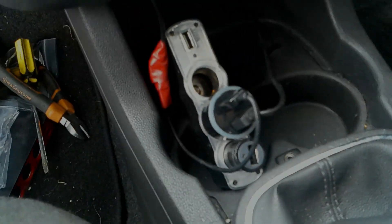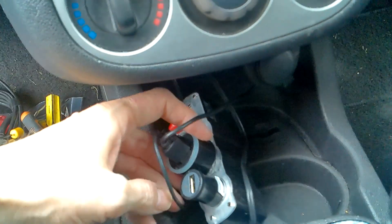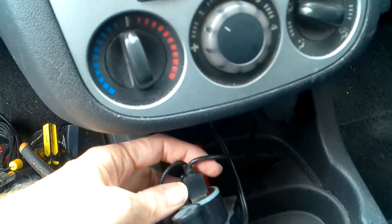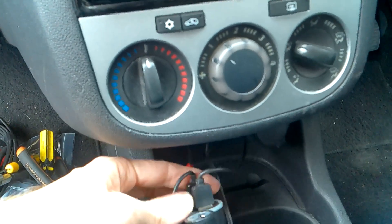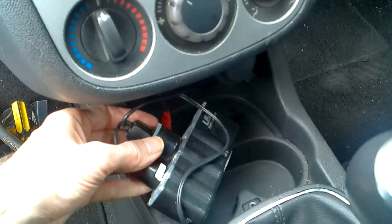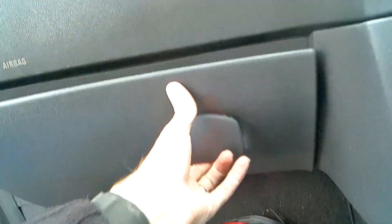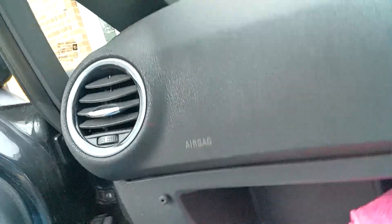The aim is to solve this problem down here, where we've got a couple of USB powered devices - there's a dash cam and a reverse camera - and as you can see it's all a bit rattly and not very neat. The preferred solution is to put the adapter into the glove box and wire it all in behind there, so you can hide the wiring a little bit better. The first thing is we take the glove box off - that's fairly straightforward apart from all the rubbish that's in it. There are just a few hex screws either side to undo.